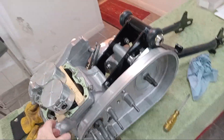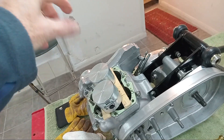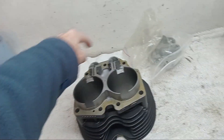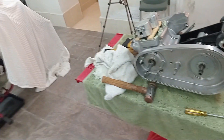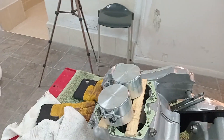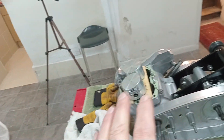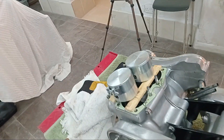I've got my two little bits of wood and I've sat the pistons on them so they'll support it as we knock the barrels down. I'm going to loosen that clamp off and wipe any excess oil off the bores. I've put well seal on the bottom and assembly lube on the bottom of the tappets. I'll get the camera set up - I sort of laugh because I hate being filmed doing this job. It's always one of those jobs, no matter how many times you do it, you're always slightly nervous until those barrels are down and you know you haven't broken a ring.